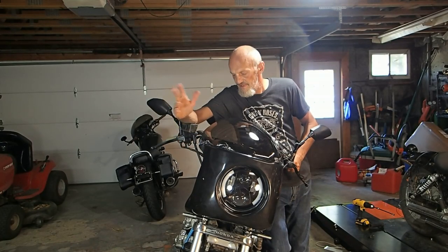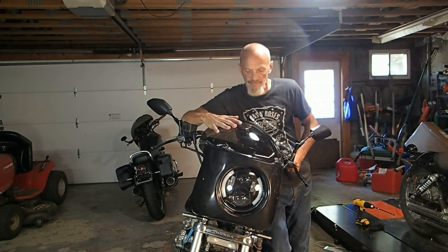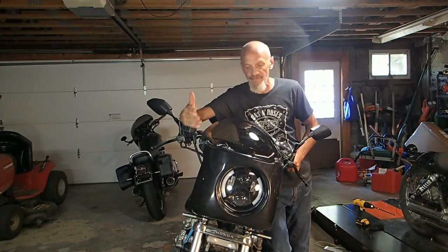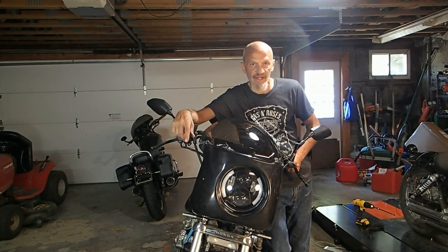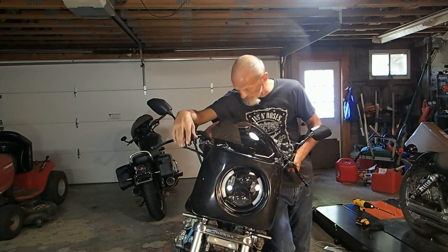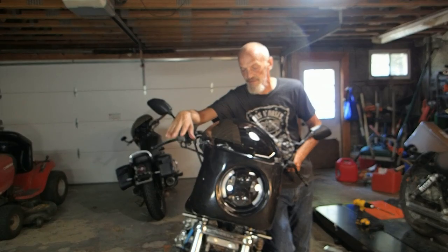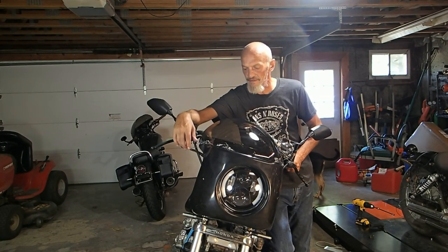All right, everyone, that's the end of this video, and I hope you enjoyed it. We've got a nice little fairing put on. We've got our front turn signals relocated because of the fairing. What I'm waiting on now are the handlebars. That'll be probably next. We've already rejetted the carbs, so we're good there. I still need to tune it a little bit, but not much. It's backfiring a little bit on the exhaust. So yeah, we've got the fairing on, turn signals relocated, and that'll be it for the day.